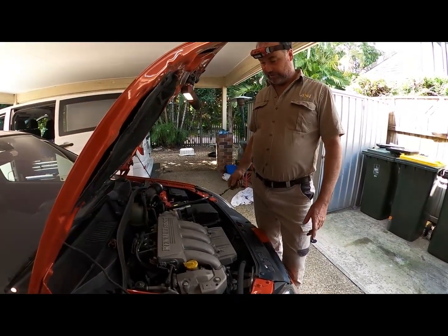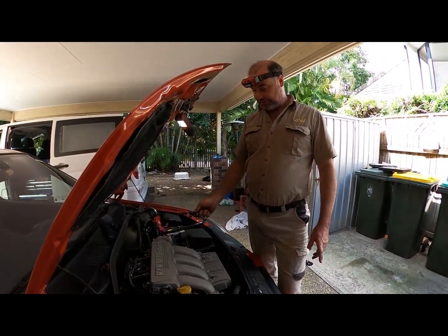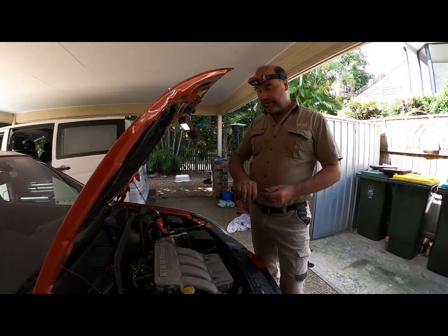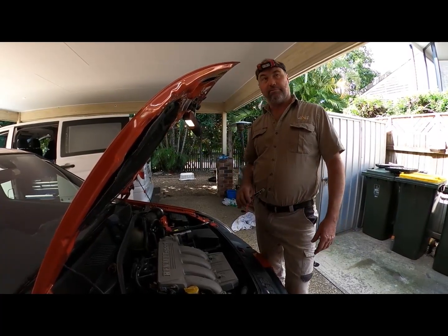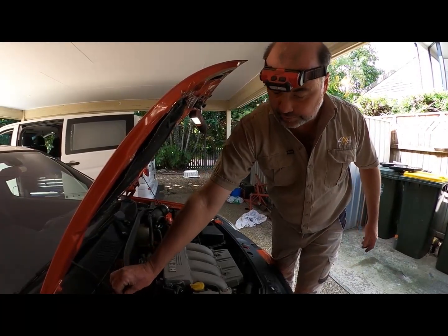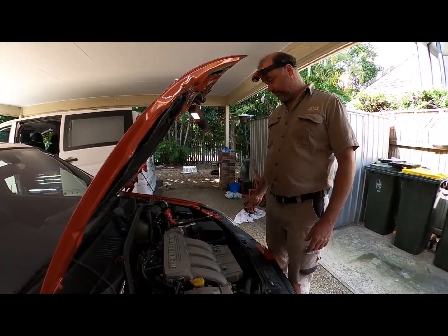Then they would have shifted the RPM. I don't believe they changed the camshafts, but I do believe the ports are smaller. So they've just really shifted that power up the RPM range. And that's kind of what it feels like. Yeah, that's how it does feel to me, having driven it once, but that's not going to make it doughy off the line.